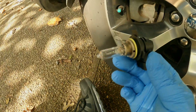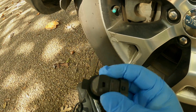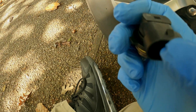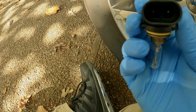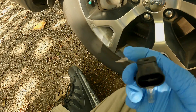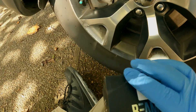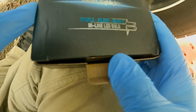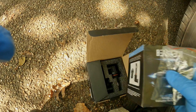So I've got the first bulb out on the driver's side — that's what the bulb looks like. It did have a little tab to hold and lock itself on there. I just used a thumbnail to pry the tab and pick up on it to get it free. Now on to these new boys, because those headlights on this Jeep are absolutely terrible — it's like driving with fog lights.